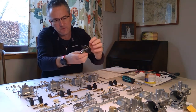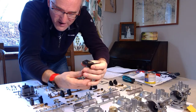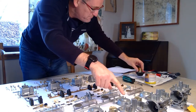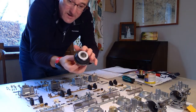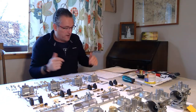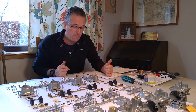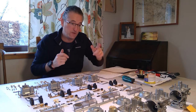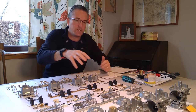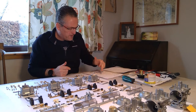I had some replacement diaphragms done by someone but found them really thick and wasn't sure they'd allow the slide to lift well. One of my diaphragms was really damaged, so I bought a whole new genuine Mikuni slide with diaphragm - you can get these for about £65-70. NRP Carbs are great guys - about £66 including postage. Obviously doing that times four really adds up. Alternatively, some suppliers will sell you just the diaphragm to fit yourself, or fit it for you.